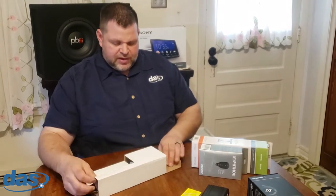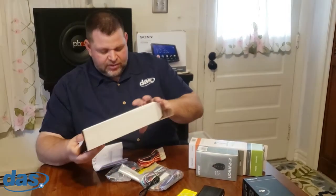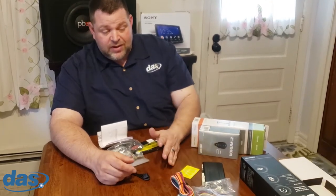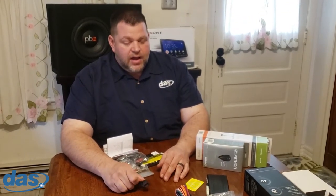Now this can be a little intimidating for some new installers, but keep in mind most of the time when you're using the DS3 or DS3 Plus you're probably going to want to use a T-harness. You can certainly do it without one — these will work in older vehicles — but they have really good T-harness coverage. It also gives you a lot of channels and flexibility so you can do creative things like make a convertible top open or a sliding rag move back and forth.